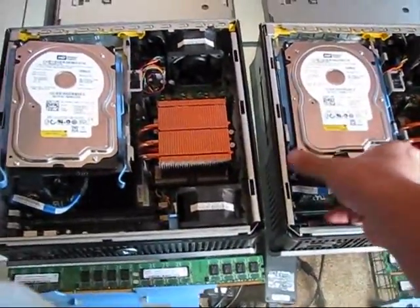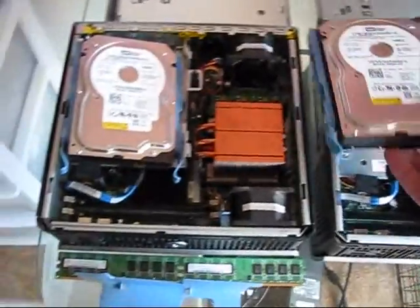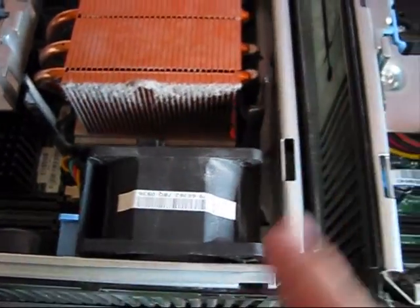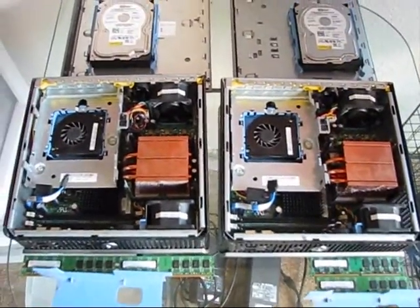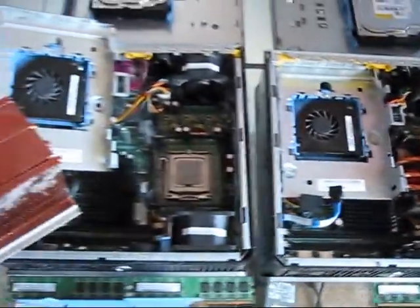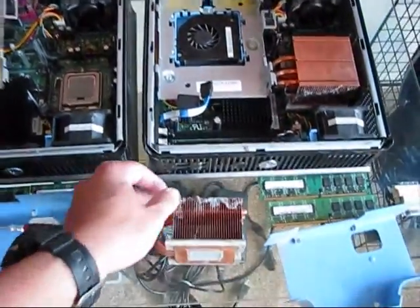The hard drives have to be removed on both of them. As you can see, the heat sinks are pretty dusty — you can't obviously say it's heavy dust deposits, but anyway everything has to be completely disassembled. The thermal compound is almost gone, but not that badly. On laptops usually it disappears completely. Here is a different picture — as you can see, it's almost gone, which is not good at all.